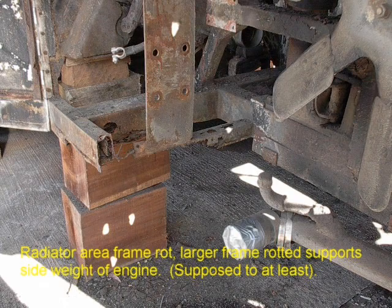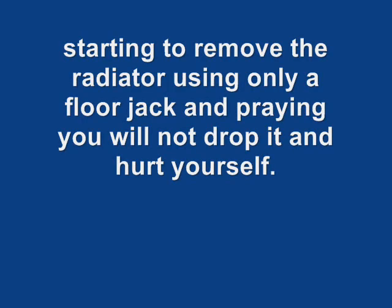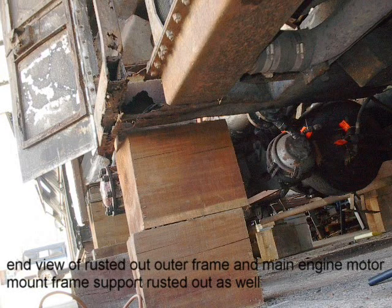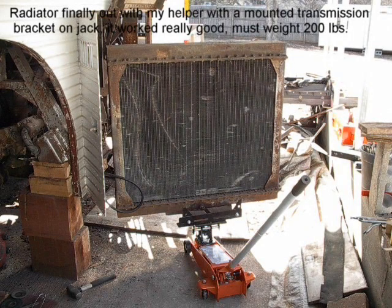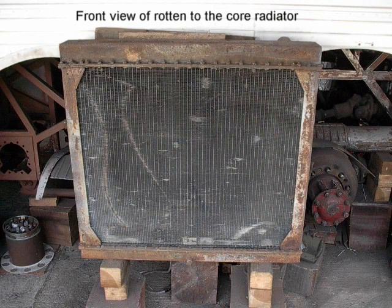View all the photos carefully. Even in these photos you cannot see what I did and what I had ahead of me. Removing the radiator was a challenge right off, as the framing of the bus was welded to the tanks of the radiator from rusting over its lifetime. I am assuming the radiator was filled with tap water and not distilled water, and this further caused so much rusting when the radiator and piping probably leaked over a period of years. I used the assistance of my floor jack to help remove and balance the radiator when I finally did get it out. This is a challenge to do alone — removing the radiator without help when it is available, please do this with assistance. She weighs about 300 to 400 pounds.